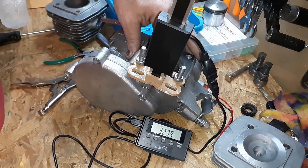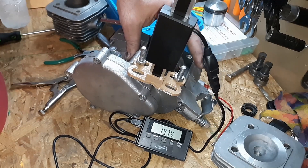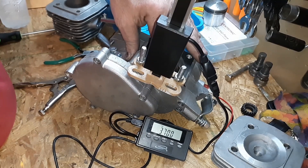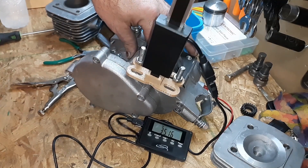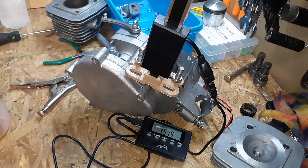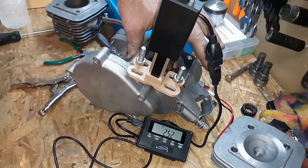Let's go all the way up again. It's about to go over and back up. So there is a 37.2 millimeter crank. That is definitely interesting — it claims it's a 40 millimeter stroke, but we're not even at a 38 millimeter stroke. This would make a killer saw build crank, anyway.